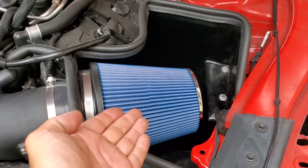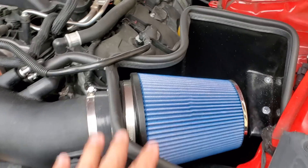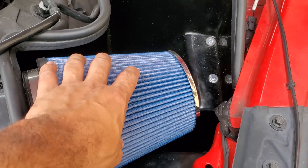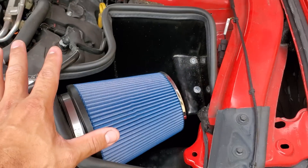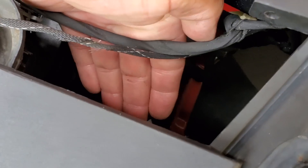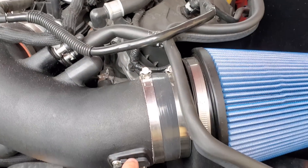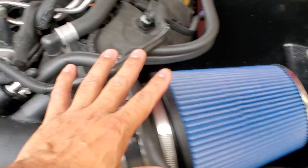Let's talk IAT. Do you think this cold air intake is going to have higher or lower IAT than a stock cold air intake? An open air element trying to seal up in the hood is still pulling warm air from the engine bay. An open air element at idle, parked, or cruising is always going to have higher IAT than anything covered. That doesn't mean I'm endorsing all covered cold air intakes, because some aftermarket covered ones don't perform well. But from the factory, they come sealed for a reason — with a snorkel that samples air from outside the engine bay. The mass airflow sensor has an IAT built into it, and if you have 140-plus degree inlet air temperatures, the car is just not going to run well.